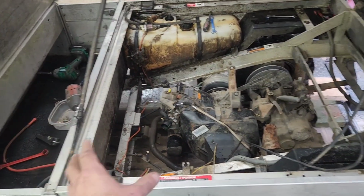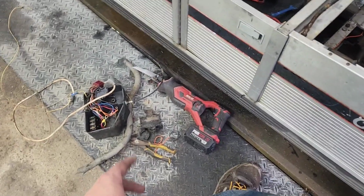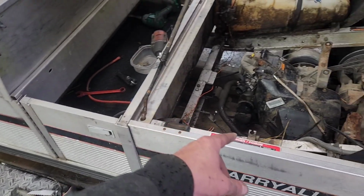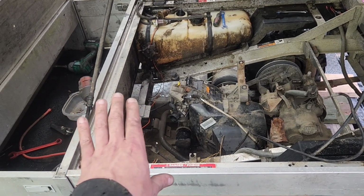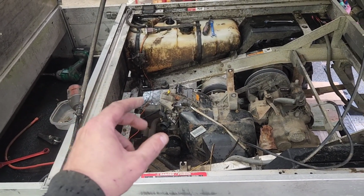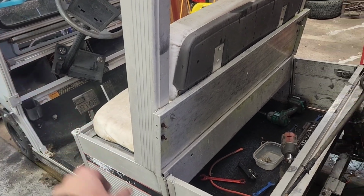There are literally generations worth of fix-it connectors through this whole entire thing. There's one of these yellow wires that has been patched together like 5 separate times rather than just run a brand new wire. It's all getting torn out. I'm not going to deal with gremlins afterwards. We're just going to take 4-wire trailer wire and run a line right square to there and put the ignition up front off of the engine and call it good.